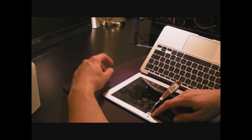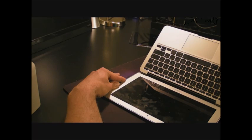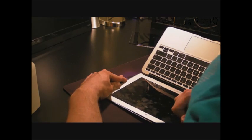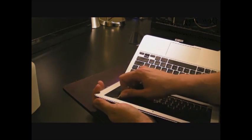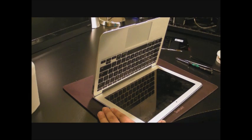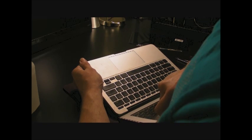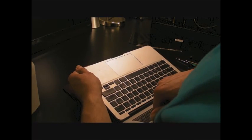Now I've gone about halfway. There is a tricky part right here — the camera. This little camera board is very easy to damage; it's pretty much touching the bezel. When you slide in the knife near the camera, pick it up about a millimeter or two and keep sliding with it lifted. Don't slide all the way through or you will damage the camera. Add a little more alcohol. Once I get through the first two sides, I don't heat it up as much because it loosens up enough to just slide along the side and take it off.